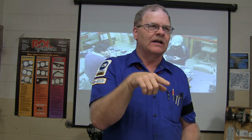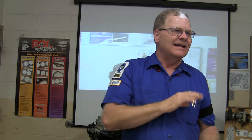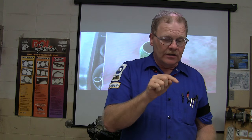But anyway, we've got two college vehicles. We've got a Dodge Stratus, and you might have seen that gray van that y'all work on. That one is flex fuel, and so is the Stratus, but it doesn't say it anywhere on the car. You can look at the eighth digit on the serial number and tell if it's flex fuel.